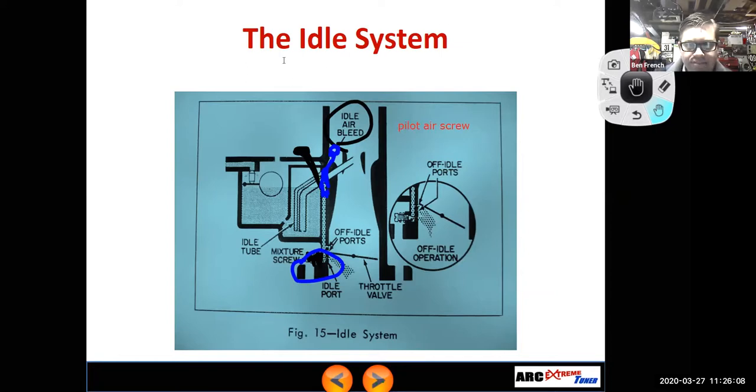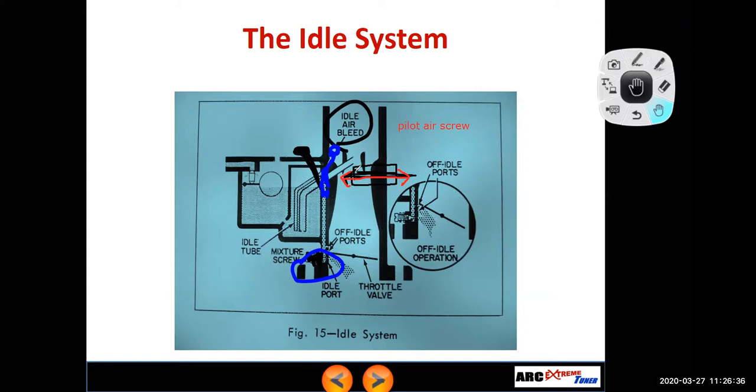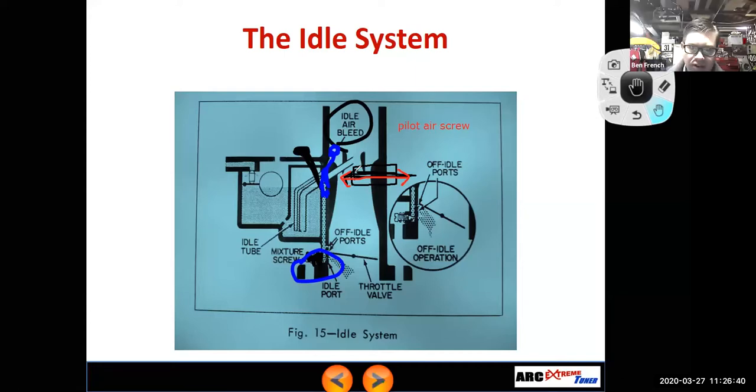All right. So on a motorcycle, they have a slide that comes in and can move in or out, and it can vary the size of the Venturi. Yes, this is looking really ugly. Those slides traditionally were round. As you get to more modern motorcycle carburetors, those slides are flat. So when you say you've got a flat slide, it means that this sliding piece, this variable Venturi, is flat and not round. And then they'll go, how many millimeters is it? Remember, the idea is that the bigger the Venturi area, the more air can flow through the carburetor and the more power you can make. You ever hogged one out?